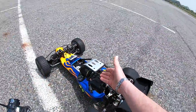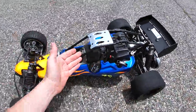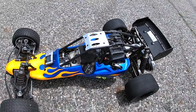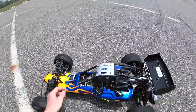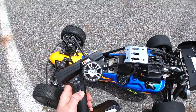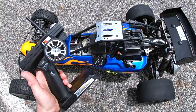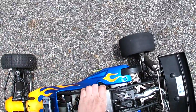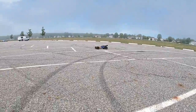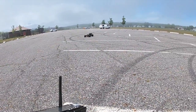It returned back to idle quite well. I don't know what the big issue with these fake eBay Walbro knockoff carbs are — I've experienced absolutely zero issues with it so far. You saw how it started, no choke, nothing. So what's the big deal guys? It came with a fuel line and a bunch of everything else that I sometimes need. Alright, I'm gonna turn it back on, gotta disengage the kill switch so it's not cutting spark to the plug.